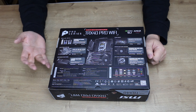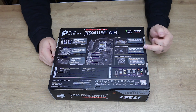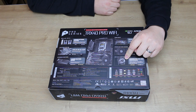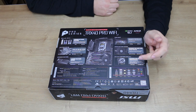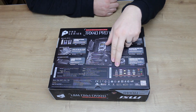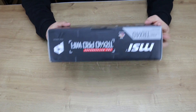Lightning USB 20G, extended heatsink, core boost for enhanced performance, a frozen heatsink design, and up to 4x lightning Gen 4 M.2s. It looks like they include an extra card which you can plug into a PCI Express port to add 2 more M.2s — it doesn't say optional so I'm guessing it's included. It also shows you a picture of the rear IO plate so you can see all the USB ports, WiFi, LAN, audio, a clear CMOS button, and a flash BIOS button.